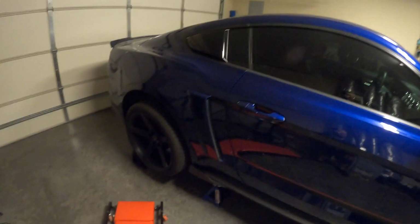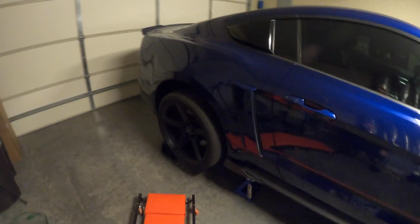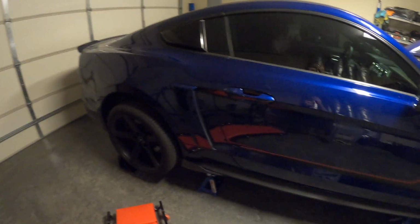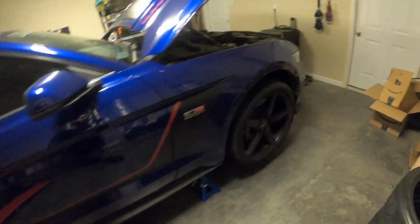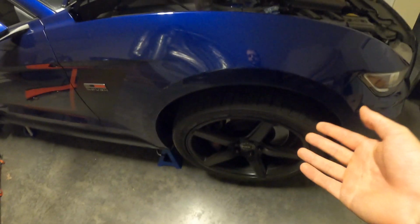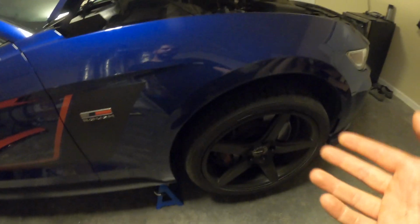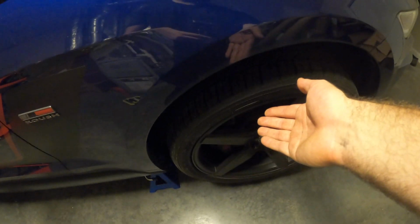And once you have that coming through, it should only take maybe, for your farthest brake line, 30 seconds, probably less. And then just close that bleeder up and move on to the next one. And you literally just do that in all four corners of the car. On a car like the Corvette, or on the front brakes for a performance pack S550 Mustang, which is what this car started its life as, this has 6 piston Brembos.